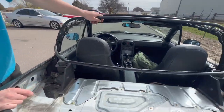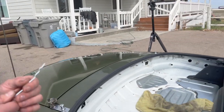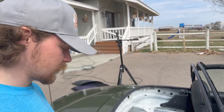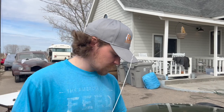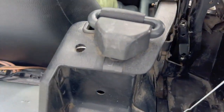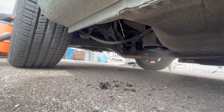You can see this car is actually white from the factory — I think it's been repainted twice, black and then this kind of cool green. We've got the well kind of cleaned out. One big thing you want to do while you have good access is clean out the top drains. They get plugged up with gunk over the years, and if you don't have them completely clear for water to flow through, they plug up and water will collect around here and you can get rust. So we're going to run a coat hanger through and make sure we're clear — this should go all the way down to the bottom of the car. You can see we have some compost coming out.